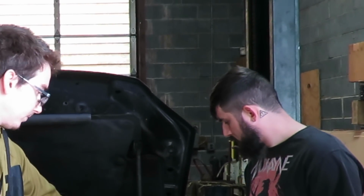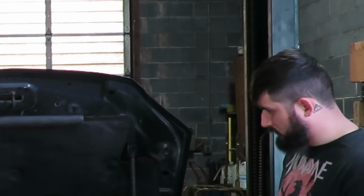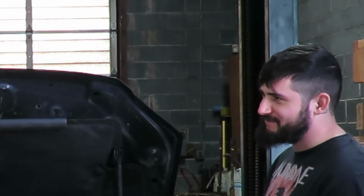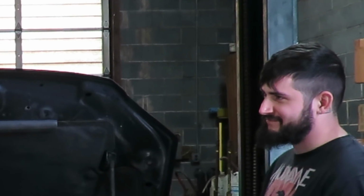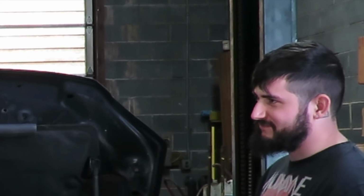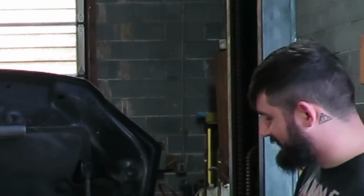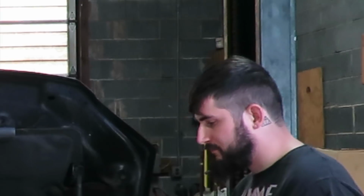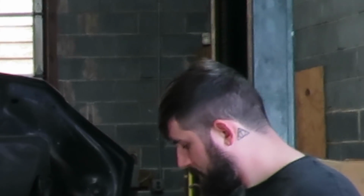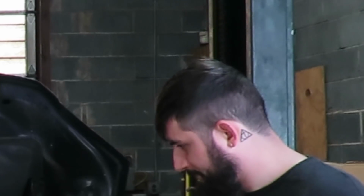You have coolant. Coolant is there for what? We just discussed this yesterday. Cooling down the engine, giving you heat in your car, stopping it from overheating and stopping it from freezing. It has a boiling point. It's a 50-50 mix of distilled water and coolant concentrate. It has a max freezing point and a max boiling point.